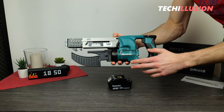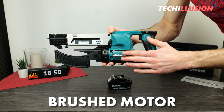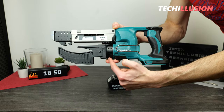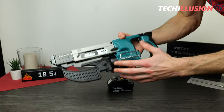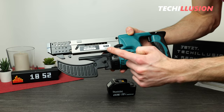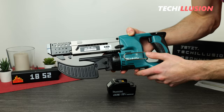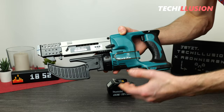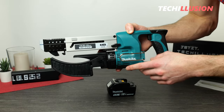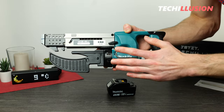Now the built-in motor. It's definitely not a brushless motor, as we find in almost every new device, but a brushed motor. There's a black cover at the front underneath which the two carbon brushes are hidden. It's a bit of a double-edged sword: we have the advantage of easily changing the motor's carbon brushes for an almost infinite motor lifespan. On the other hand, a brushed motor is not as powerful and is significantly less efficient compared to a brushless motor.